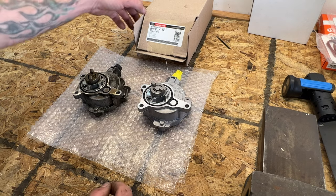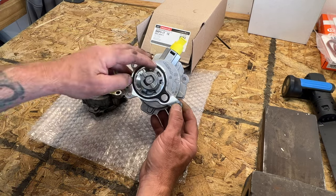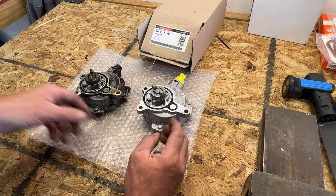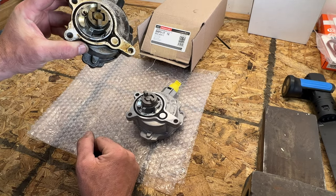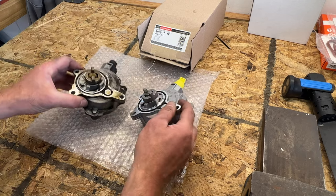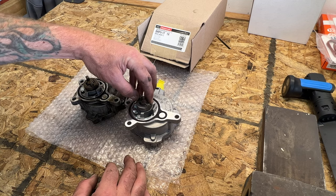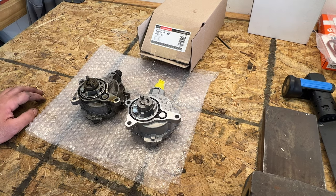Let's take a look at our new vacuum pump. I went with the OEM Motorcraft one — part number BR-PV-17. I'll put a link in the description. As you can see, it comes with a new gasket. I'll also try to find just the gasket alone and put a link for that too. If you take a look at the comparison on the gaskets, you can see how flat the old one is — that's probably why it ended up leaking. This one is identical to the old one — same exact thing. Flip it over: same thing as well. Line it up the same way it was so it'll go in correctly.